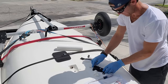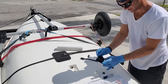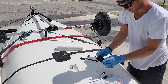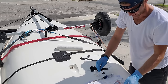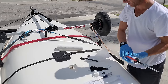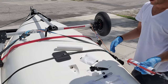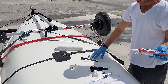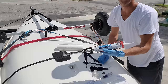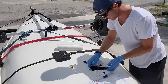Figure out your spring situation — whether you're going with the stainless steel plate, the green and red paper clips, or the rubber bands. You're also going to need some 5200 sealant. This is essentially for deck holes, through-fittings, or through-holes — it's not meant to come off, so keep that in mind. There's also a 4200 that a lot of people use, but 5200 is my route.